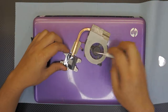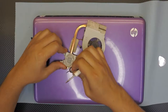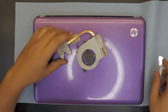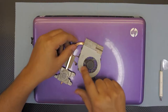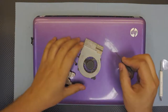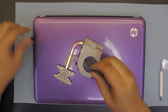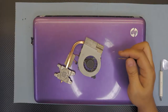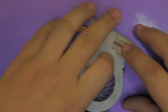What we're going to do now is grab the heat sink and remove this plastic heat sink tape right there — we're going to trash it, we don't need it. This is the important part: remove the two screws at the bottom side of the heat sink. Find your screwdriver, remove the screw right there and one right there.